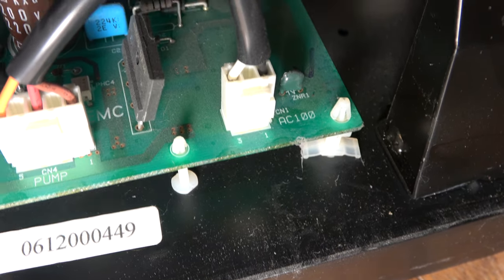Unregulated, yes. I guessed about 20 volts. There we should have 5 volts, which we have. 13 volts, yes we do. About 14.3, yes we do. And unregulated, oh, it was about 35, I was guessing. Okay. So we now know that the power supply is working and what voltages we should get on it.